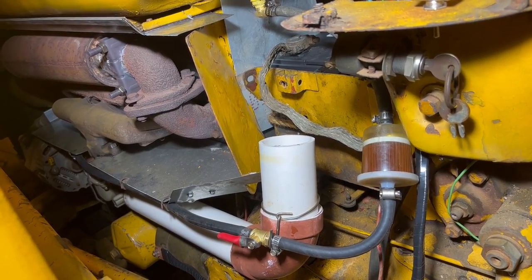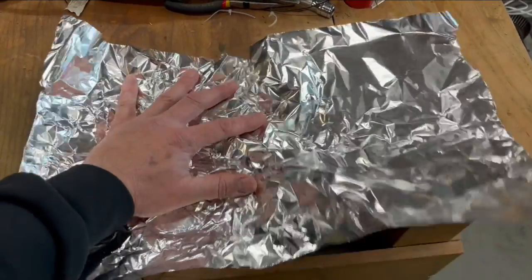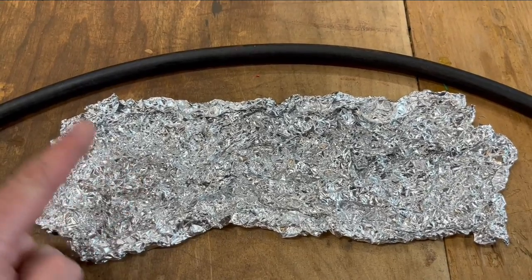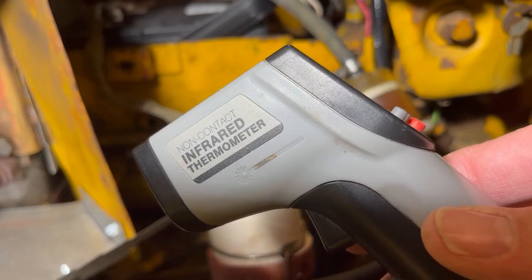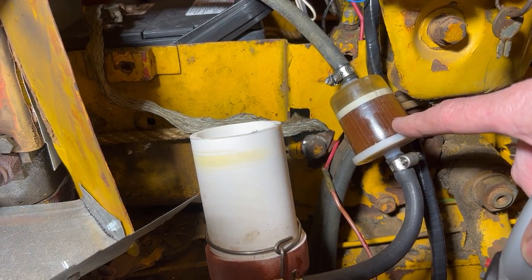With that shielding in place, I never get over 120 degrees. Another good technique is to crinkle up aluminum foil to form air pockets and wrap this around your hose. That does a pretty good job keeping the heat off. An infrared thermometer will help you find the hot spots and a clear fuel filter will help you see the vapor.